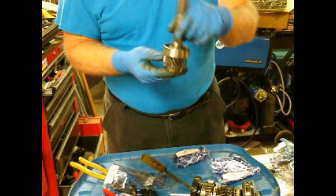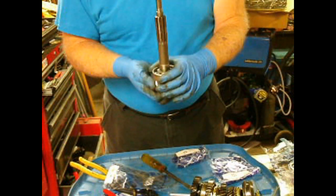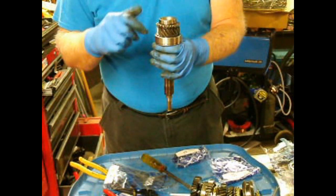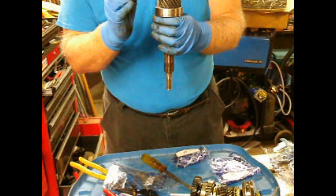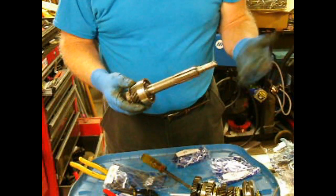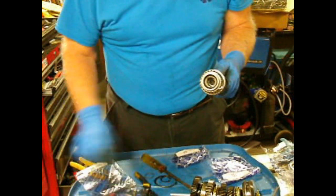If you had a press where you could put it in like this and press it, it would be really easy, but I have to go that way on mine, so it falls off the boss. So you have to keep it really centered, and a few thousandths at a time, make sure it's still moving, get it centered, and all of a sudden it's there and it's in. So it's fussy, it's a pain in the butt, not difficult.